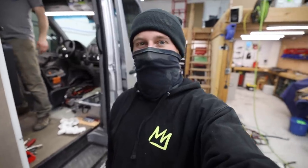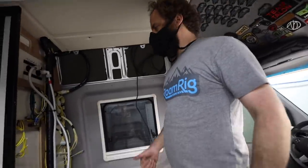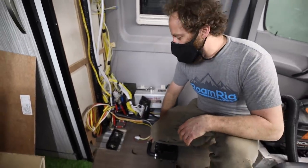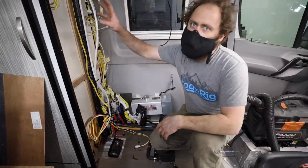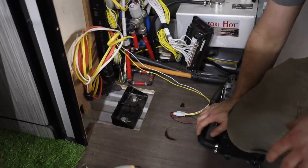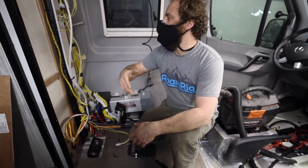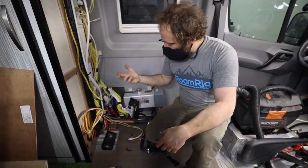We're back from a quick intermission — had some lunch and these guys are already back to work. Aaron has been chugging away and gotten a lot done. Not only are we doing the lithium conversion, but we're doing a lot of other things too. He removed the short loop for the heating system. There's a thing called the short loop, and the problem is in the winter you can only heat your tanks when the thermostat is actually calling for interior heat. So you could be in a situation where you don't have your heat turned up high enough and it's really cold outside and you still freeze your tanks. By getting rid of the short loop, anytime there's glycol pumping through the system that's hot, it will be heating the tanks. If you're running from the engine heat exchanger with the system on and hot water on, the glycol pump runs, the engine heats the glycol, and it's going to heat your tanks. Also eliminating the aquastat — that can cause the hot water to start hot, then get cold, then get hot again.